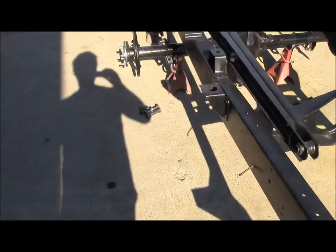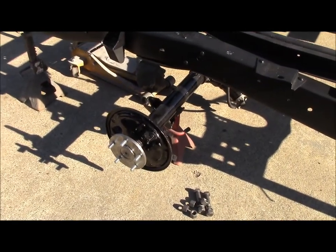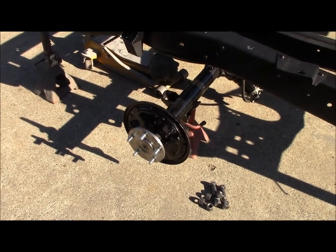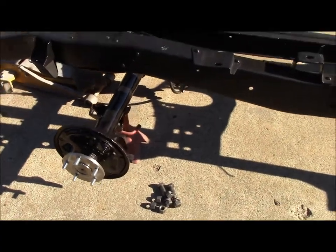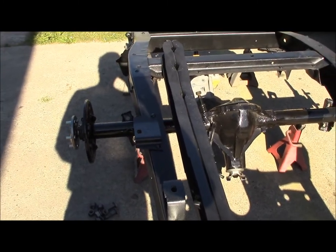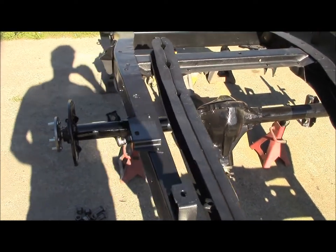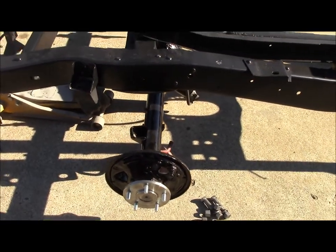The diff is all completely rebuilt, with all new axles in it. We changed the axles because the stock truck was a six bolt truck, and it's going to go to a five-on-five now because of the disc brakes. So we changed the axles to a five-on-five. For anybody that's got a 1967 to 1970 six bolt pickup, they take the axles from a '71 to '72. You can put those axles in there and then just order a set of drums for a '71-'72 Chevy pickup. There's a handy little tip for you.